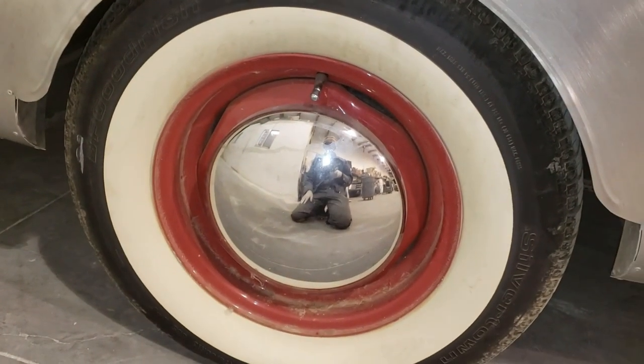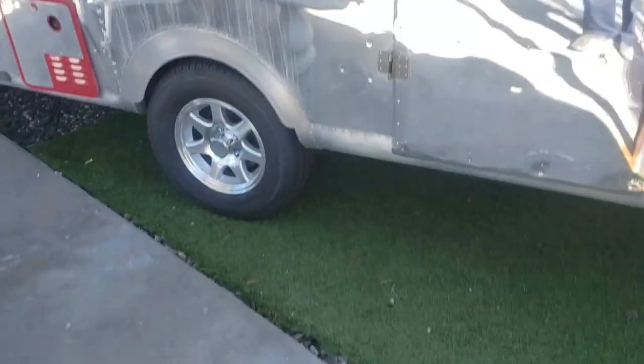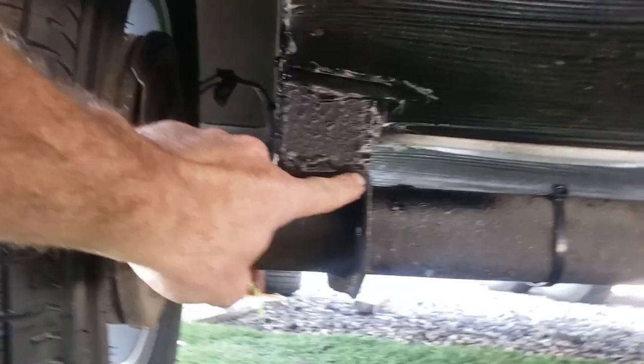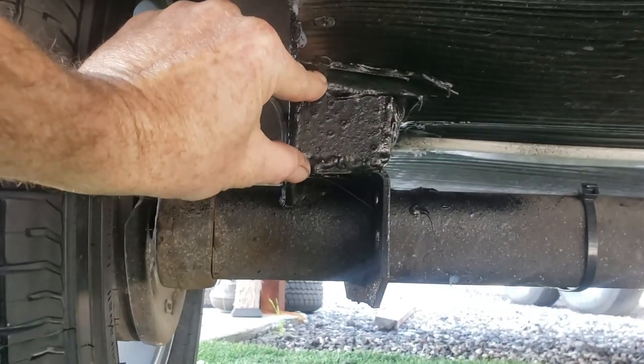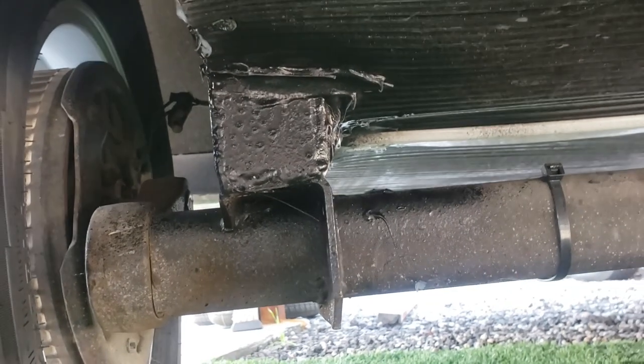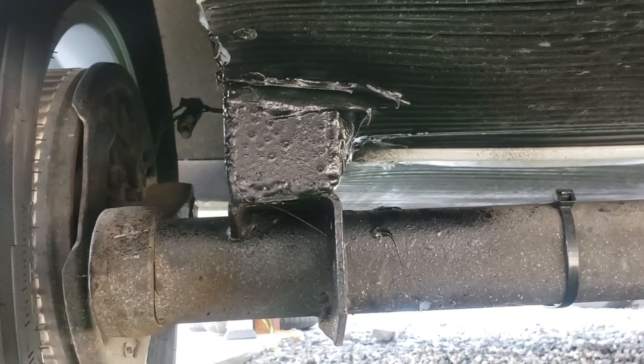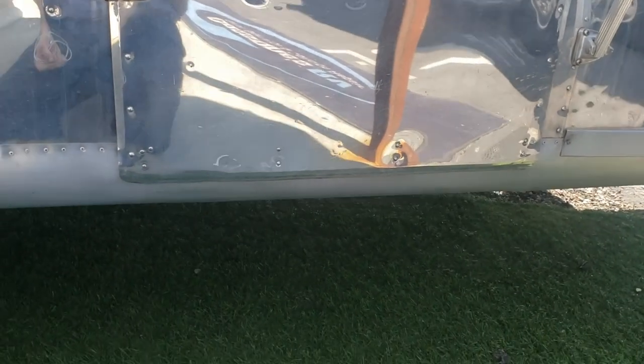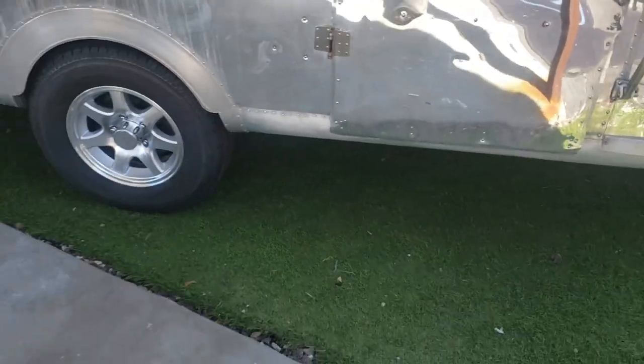You can see all the room I have up here on this side, so I have to see what he would like to do. So we got this thing put back together. We had to cut off the axle where it was welded onto the frame and welded up about two-and-a-half-inch blocks on each side, so we have quite a bit more clearance. A 13-inch tire is a lot shorter than a 14-inch tire — not just one inch. Now we have all sorts of room underneath right there, and it was really effortless to climb under. All we had to do was weld up a block.